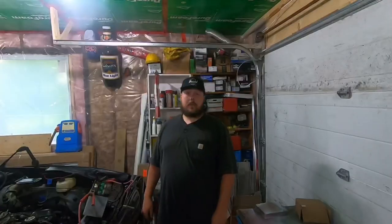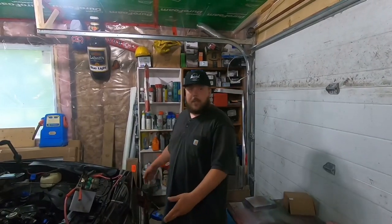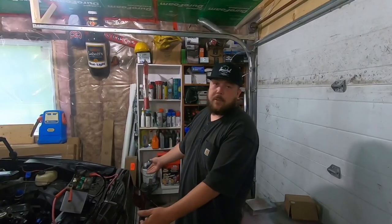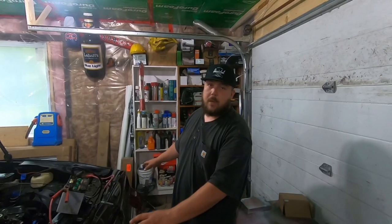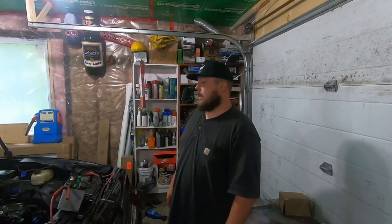Now, believe me, I realized this video was gonna be pure shit - these headlights didn't work. So I came out here this morning and fixed up that switch for you so we can check these out. For low beams, it runs the outsides. For high beams, it just runs the centers here. If you wanna run all four lights at once for high beam, you can wire that up yourself or you can buy wiring kits for that. You'll figure it out. I believe in you.